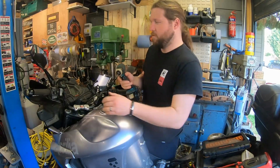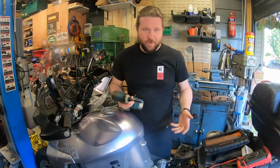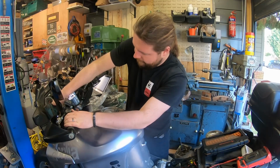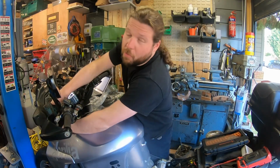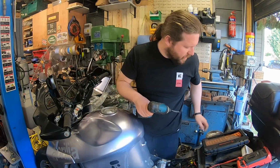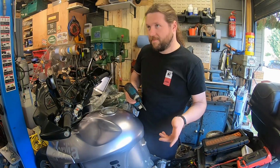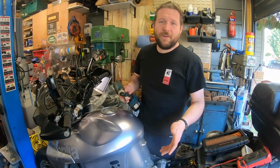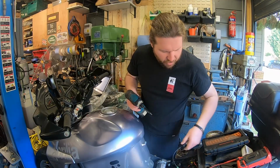We want some volts. So what older cars had as a separate item was a regulator or rectifier. No, a regulator. Very old cars also had a rectifier, because when you had dynamos versus alternators, they made DC, not AC. Anyway, a rectifier changes AC to DC, because you only want one.